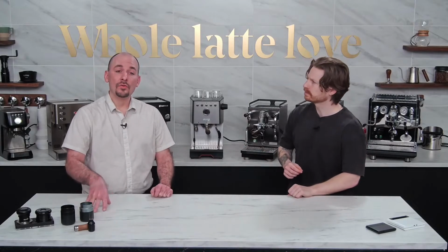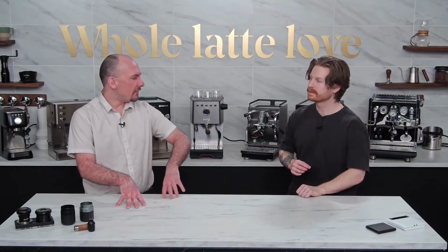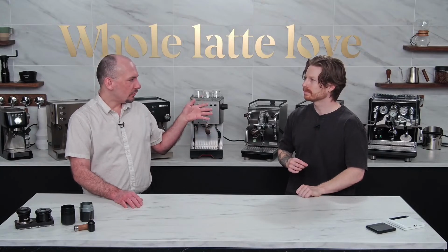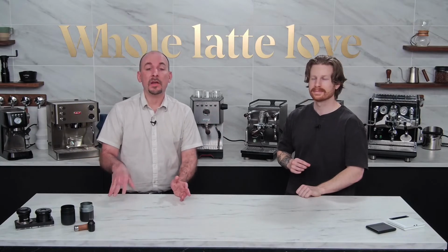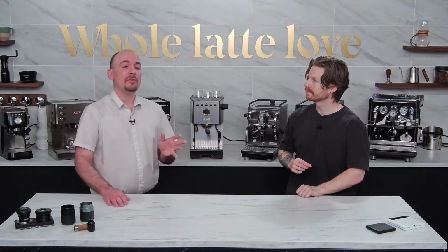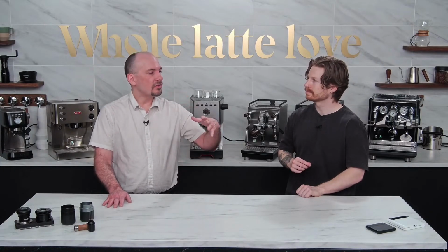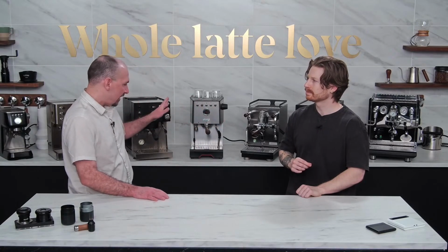Yeah, and I think those sorts of experiments are easier to perform when you have a machine that has the ability to change or control your flow rate a little bit more. And I think that's where flow control, for instance on an E61, can be a very useful tool. So one thing to bear in mind is that on many of these machines, the way pre-infusion works is simply that either the solenoid valve will open or the pump will run, and it's not necessarily changing the flow rate. But that's not the case with the Classic GT.